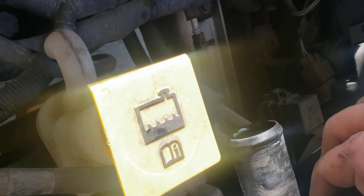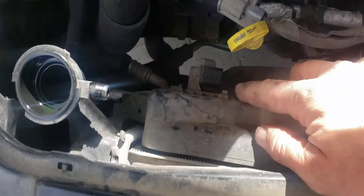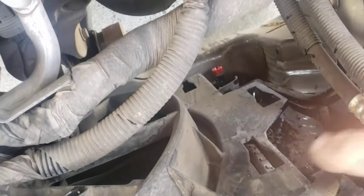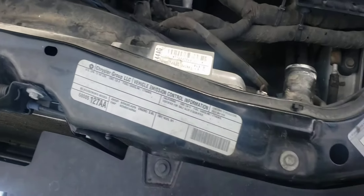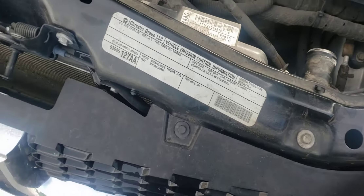While I'm here, I'm going to run some water through the radiator to kind of flush it out. He's been having overheating issues — he thinks the little resistor on the fan is not working so it's not speeding up, and he just wants me to put a new one in. Looking at the fan, it just lifts up — there are just these little notches that slip into the fan right here, and that looks like about all we've got to deal with.